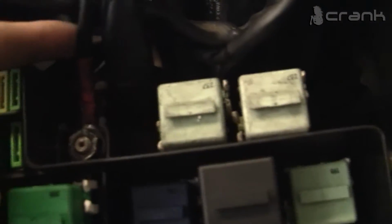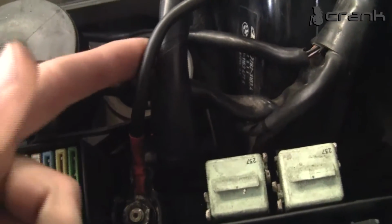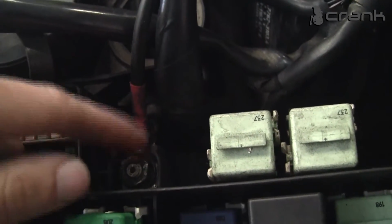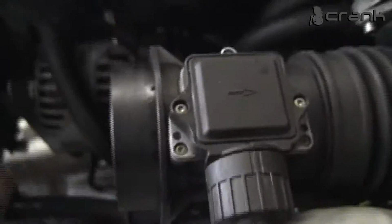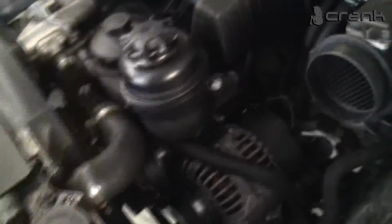So the red wire, at that time we were figuring out where it goes. I think this wire is for the fuel pump. When I touched it to a 12-volt supply, I heard the pump running. So I just put it right to the main supply cable to the fuse box. What else? We put in coolant and hydraulic fluid.